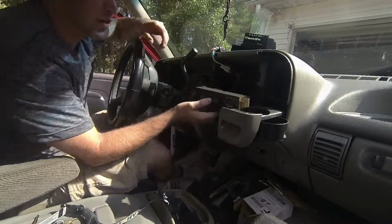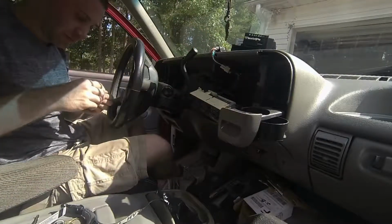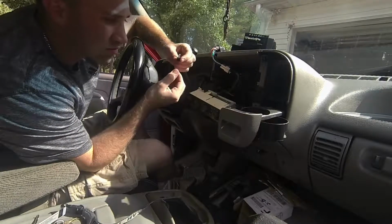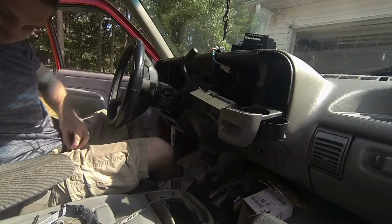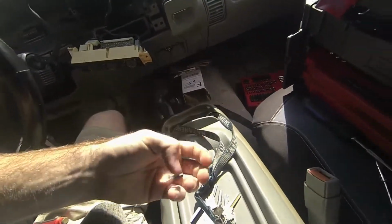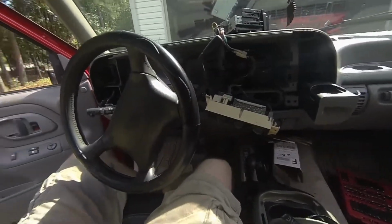Okay, so that's why I'm just going to take out the top and do my 4 bulbs like this. From Super Bright LEDs, those come, I guess, already with the little mounts, so that makes it really easy. To turn a few of these, you might have to use some kind of needle nose pliers, because you don't have a whole lot of space to wrap your finger on the backside. 4 new ones in. The 4 original ones are out, as well as the 2 220-degree bulbs from the cluster. So now we can just begin the assembly.